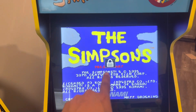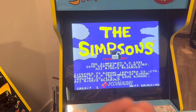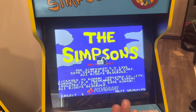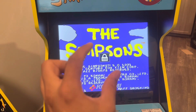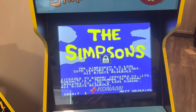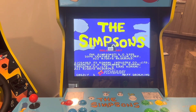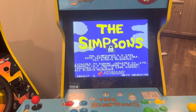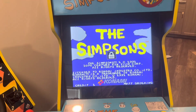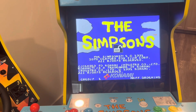You're going to see a lock on the screen — I have an issue with this monitor. The bezel is pressing into the menu buttons, which is forcing the button down, and because it's pressing against the button, it is constantly locking and unlocking the monitor. I tried everything I could to separate it, but it's not going to work. So I'm going to have to uninstall the monitor and shave down the buttons so they're still functional but not touching the bezel.